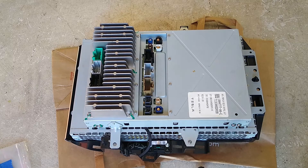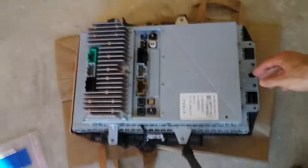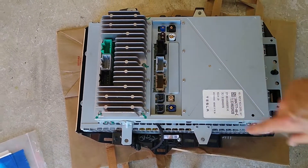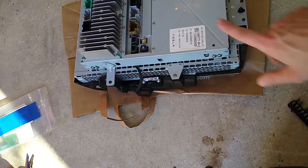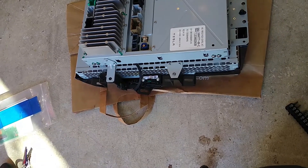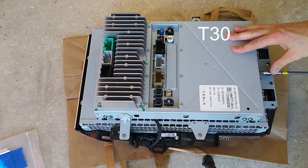If I remember correctly, there are a number of screws — these screws just connect the bezel. I just need to take the motherboard away from the screen, so there's 12 screws here on the side. I don't know why they do double screws, I just need to take those out, and there's some wires still connecting, so when I lift it away I want to be careful not to rip that wire. So let's just start taking those 12 screws out and see where that gets us.